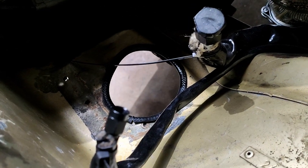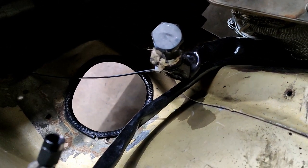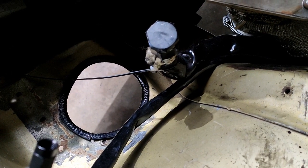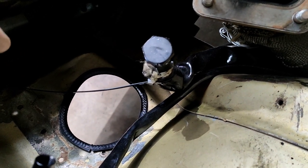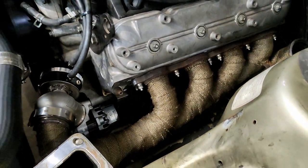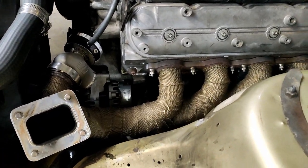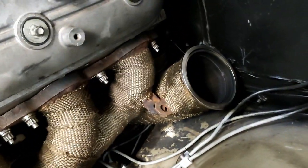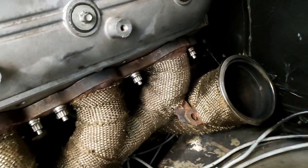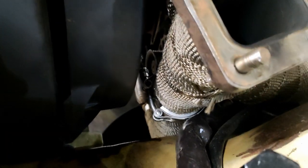The drain and feed adapters from my eBay GT45 fit straight onto the S400, which is a win, and if I can get it positioned nicely the hole will still work nicely as well. I'm in the process of taking this all off — I've kind of built it so it's hard to get this manifold off. It's easier to do everything else; there's a little hook for the downpipe that sits on top, making it hard to pull the manifold off from underneath, but I'm going to have a crack and undo the other v-band in there.